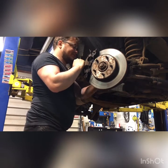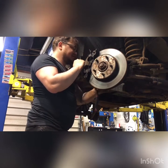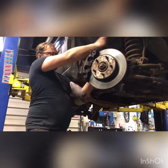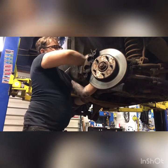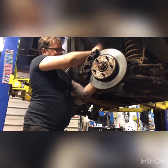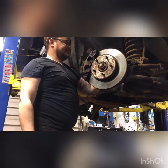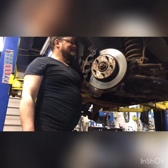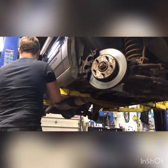And these ones are so stiff that I'm gonna have to put a pick in there or grab the ends with vice grips to get them out. Now, these bleeder screws are seized in there. I've already confirmed the other side needs a new caliper. These brakes were smoking. It's that long time. But we'll see if we need a new caliper on this side. Tried loosening the bleeder screws, heated them up, and they're just gonna snap off. They're no good.